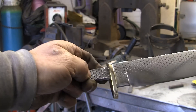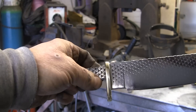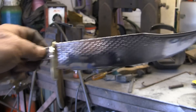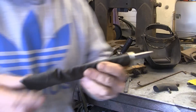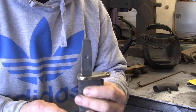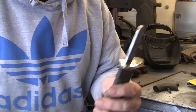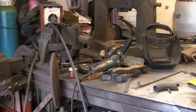Now I'm going to clean up the tang. I'm just going to give it a wash basically — wash the whole lot, get the muck out from the teeth so that the epoxy has got something to grip to. I've given it a wash and I've just slid a bit of old bicycle inner tube over the blade. Now I'm going to wrap it up with tape just to protect it and stop me stabbing myself, which I've already done once. So we're giving it a go with the epoxy.